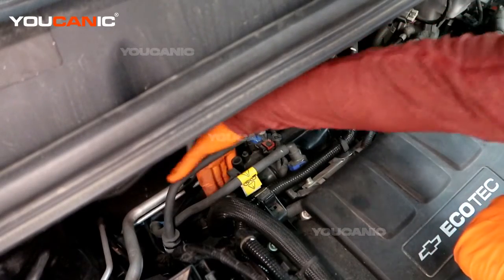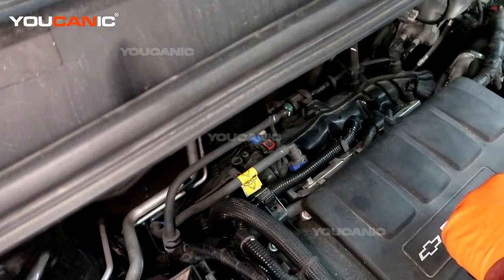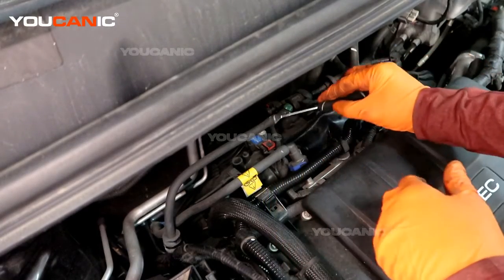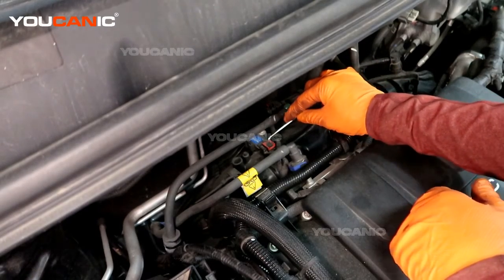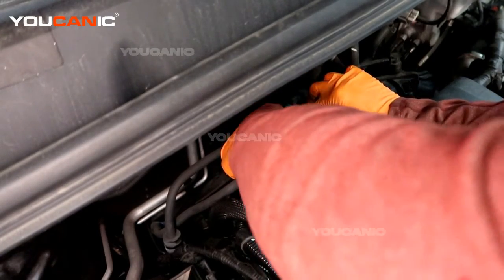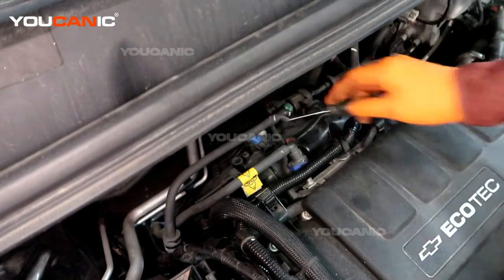You can do the visual inspection while it's running — look around and make sure you're not seeing any holes, and especially that the hose pipe coming in from the intercooler is definitely hooked up to give the proper airflow that the engine is used to knowing by the ECU. To replace this sensor, we've got to pull this red tab clip forward so we can squeeze the connector to undo it. Once that's undone we move it out of the way, and we need a torx bit.